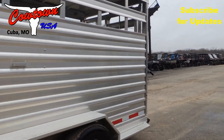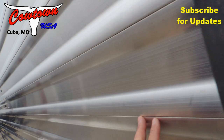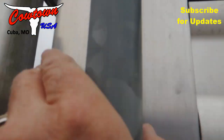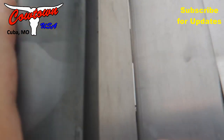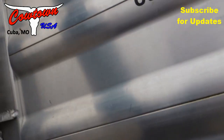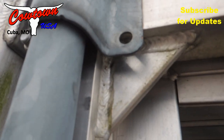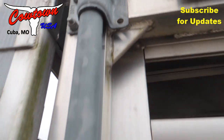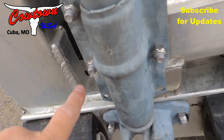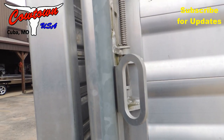Here's another big deal with this trailer. This trailer's got good, pretty smooth outsides and rolls here. But when you look inside this trailer — let me show you this — you see the size of this post? This is the post of this trailer. This is a 16. This post is so small that they couldn't even put the fourth bolt in. Look at it. I'm not making this up — bolt here, bolt here, but the post is so small. Compare that to the Winchester Star.